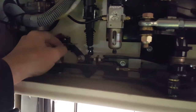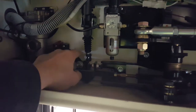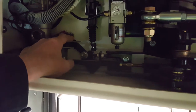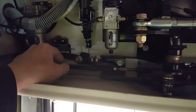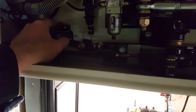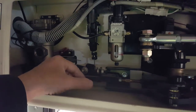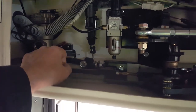So we're above the entrance door and here's the van lock on an International. You can see the lever — it's actually in the micro switch. So it's going to start, but if we move the lever down, like I said, what's been happening on rough roads, it eventually works its way down until you try and start again. Nothing's going to happen until you actually cycle the key and try and start the engine.